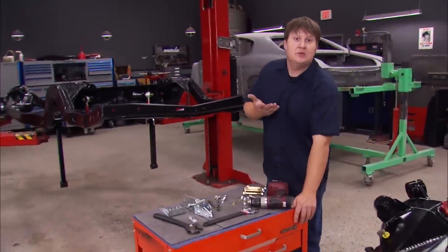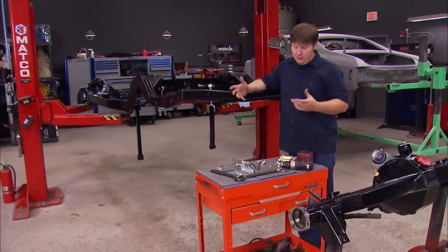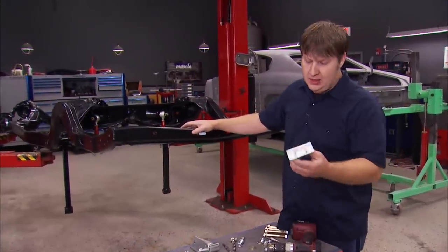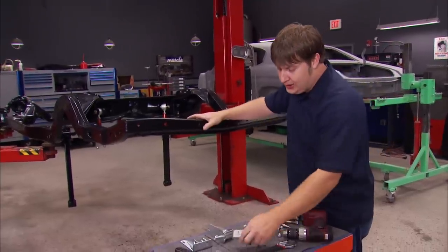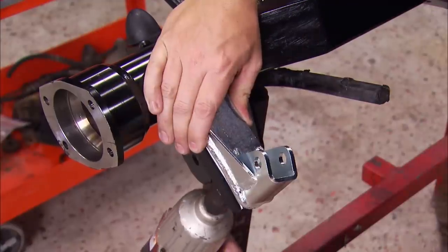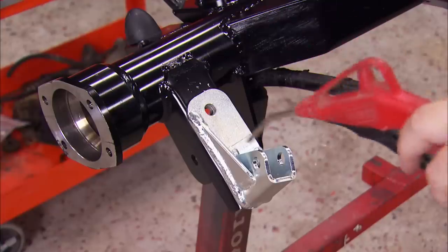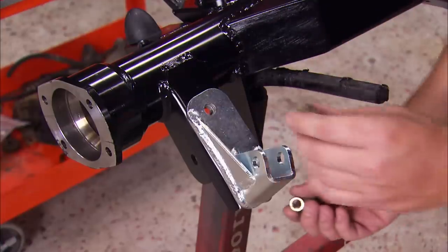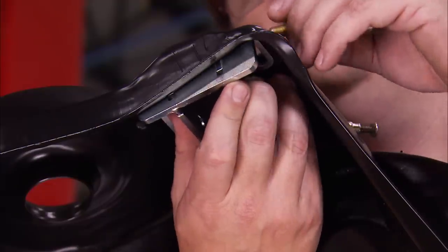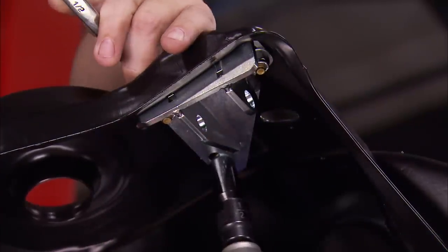The rear end is all shined up and ready to slide up under the frame. We've installed the QA1 links, but we're doing a coilover conversion on this car, and back in the day they weren't thinking about coilovers. QA1 offers a set of brackets that will adapt it for us — all we have to do is drill a couple of extra holes. The bracket bolts to the original lower shock mount bracket on the rear end. After drilling a pilot hole, we upsize bits to accept a 7/16-inch bolt, blow off the metal shavings, drop in the bolt, and cinch it down. The frame bracket has two existing bolt holes, so we install and tighten those two first, which helps line us up to drill out the frame for the third bolt.